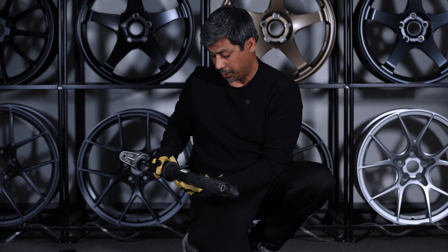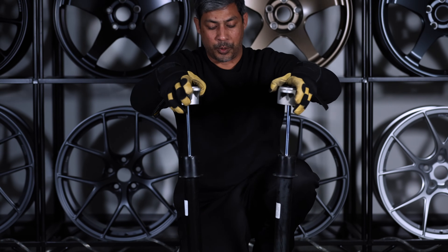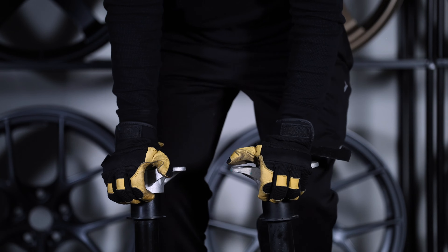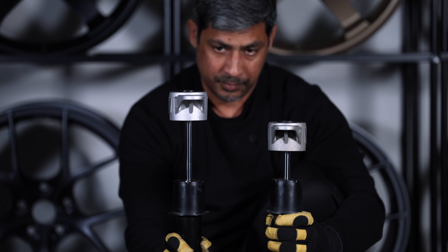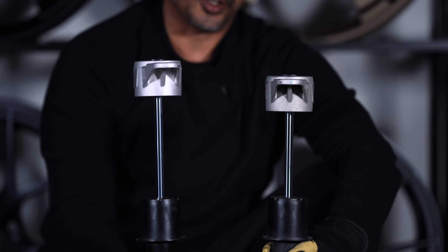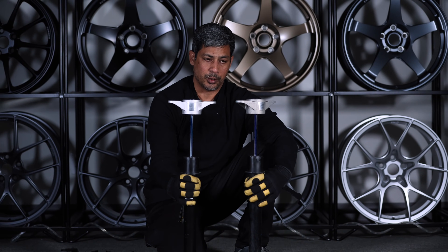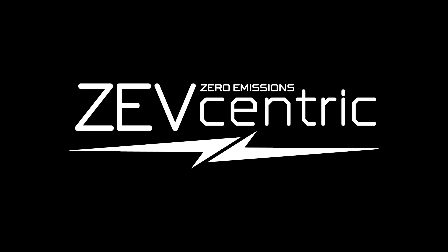Let's check the part numbers — there's actually no letter suffix on the 2020 Long Range unit. Switching to the rear comparison: the 2023 Performance versus Tim's 2020 Long Range. They're pretty similar on compression, but the Long Range was a little easier to compress, and there's faster rebound on the newer Performance by a lot. Tim's shock may have around 20–30,000 miles on it — he did upgrade to coil-overs and has now gone back to Tein Endura Pro Plus shocks with factory springs. Thanks for watching — don't forget to like, subscribe, and share.